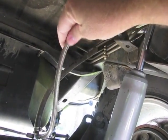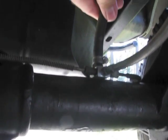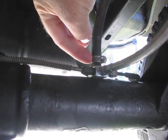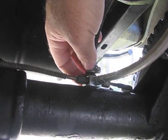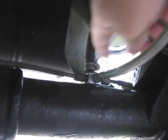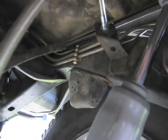Here's the rear brake line, which this particular one came with the Rubicon Express two-and-a-half-inch suspension system. It's just a matter of removing the vent tube from the axle — the barbed fitting that the vent tube attaches to is actually what bolts the brake line to the axle. You remove that and of course remove the two hard lines from that fitting there.